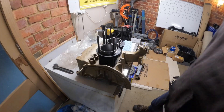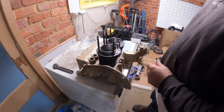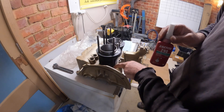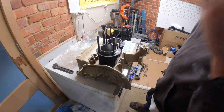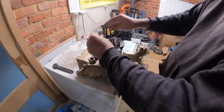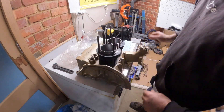One of the first things we're going to do is just get our stud heights correct before we glue them in. We're going to use Loctite 290 - that'll just seal the threads in the block so we're not getting leakage, and it's a little bit stronger than the red Loctite, so it'll hold the studs in a little bit better. I've got them all wound in as far as they go and we're going to put the head on now.